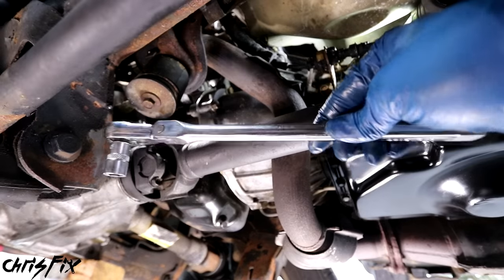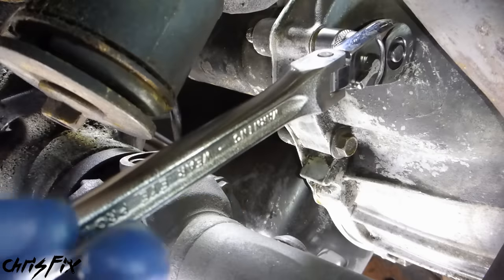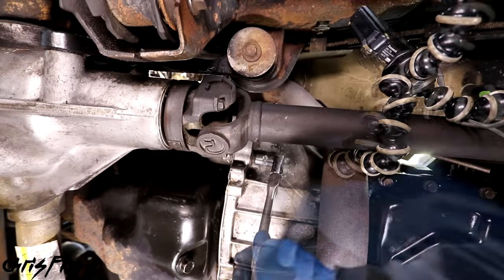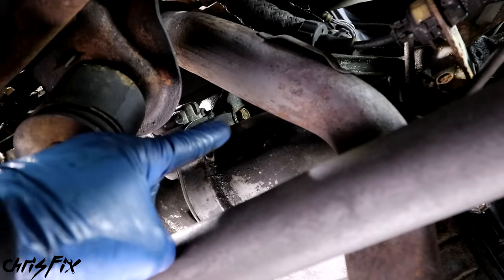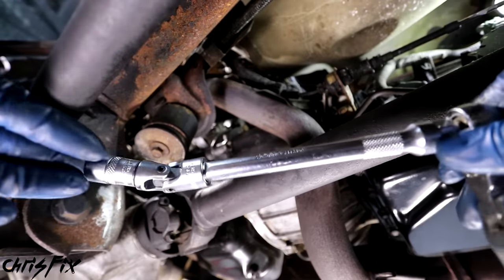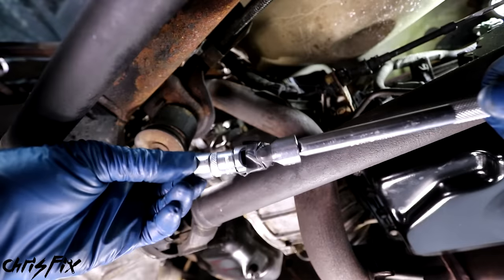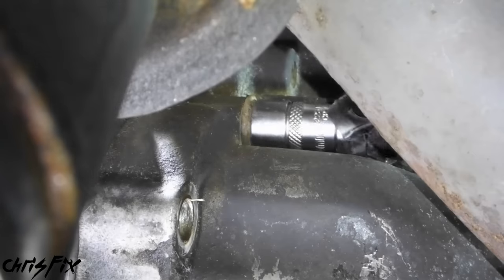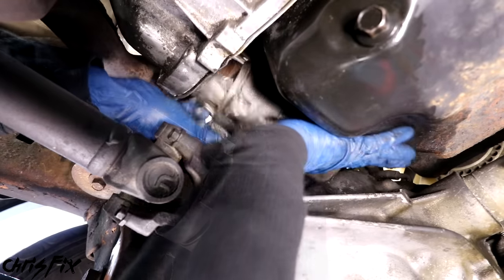Since there isn't too much room to remove these bolts, I'm going to be using a ratchet with a swivel head. There are three bolts holding in the starter. They give you just enough room to get the ratchet and your fingers in there to get the bolt out. For the last bolt all the way at the top, it's going to be tough to get to, but there's a trick - use a universal joint with an extension. The U-joint extension can be pretty loose, so a little trick is to use some black tape to limit its motion. Since this is the last bolt holding the starter in, as you remove it, make sure you hold the starter so it doesn't drop because it's pretty heavy.